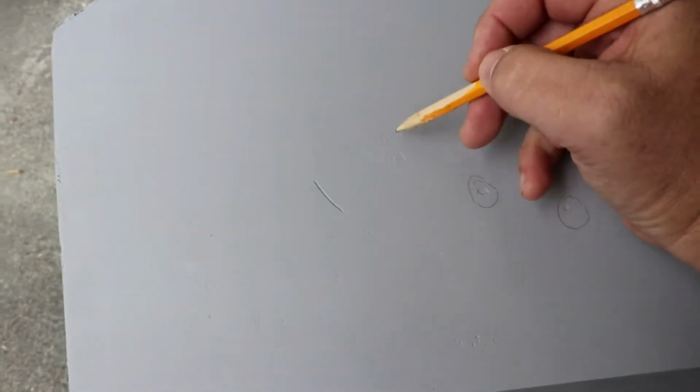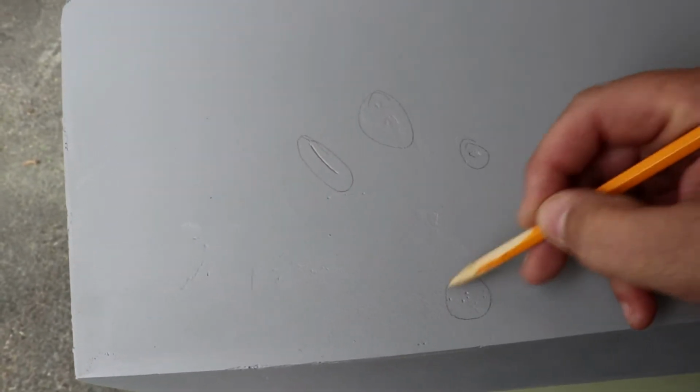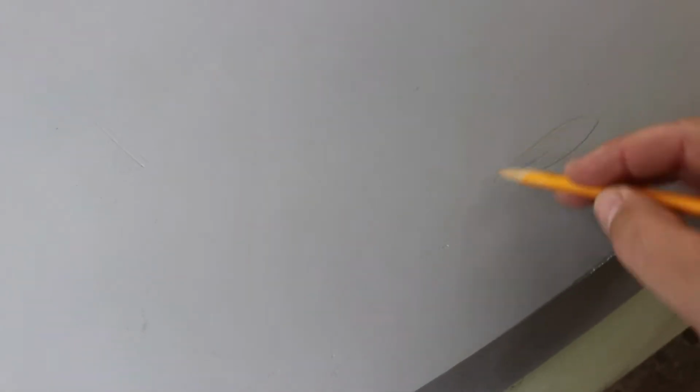All right. And again, whether or not you can see it on the camera, got a spot, a spot, a spot, a little bit of area right here, clearly a gouge. Now these might get filled in with more primer. If we just mix up some Total Fair, we can basically take a razor blade and fill these little imperfections in. Hit it with some 220 and be done with it. Yep, that right there. That looks like some weave.